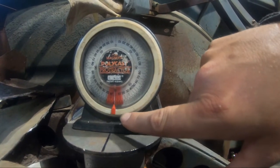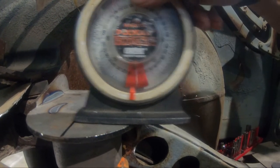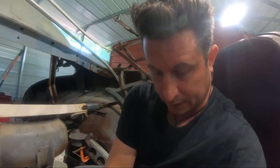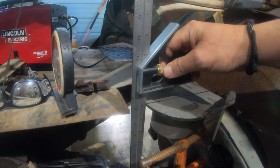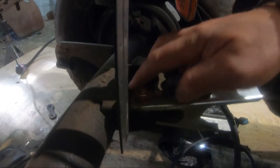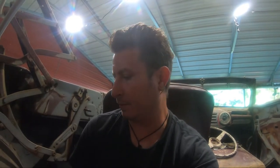Basically I've got this thing at a degree and a half so that when the frame comes down in the front it will level out. We did that with a little bit of math and a little bit of eyeball. If we line this up at center, looking down, that's pretty much going to eyeball the center of our spring mount. I also ran down the center of our bump stop and it looks pretty close to the center of our axle. All we're doing is confirming all of the stuff we've already tried to confirm is basically right.